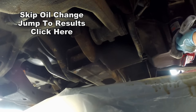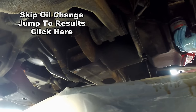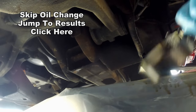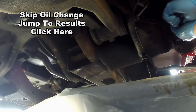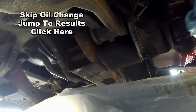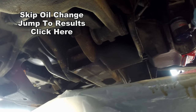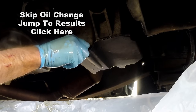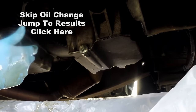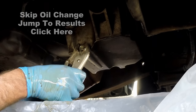When tightening up your filter, put it in there hand tight, and then get your wrench. You don't want to over-tighten your filter — if you do, it's real hard to get out. Now I'm using an oversized plug because someone had stripped this out before we bought it, so I had to buy a slightly larger drain plug, and so far it's been working pretty good. I just want to make sure we get it good and tight so there's no drips.